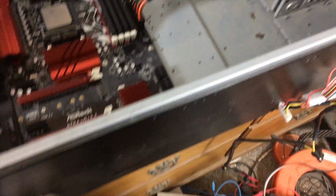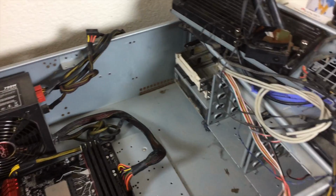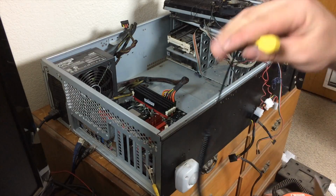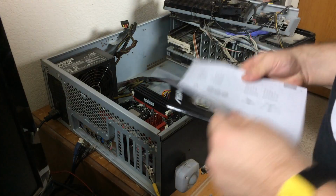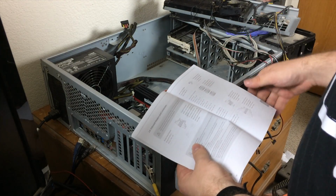RAM is installed. So now we are going to start cabling up the chassis connectors, all of which are here. Then we can start rebuilding the mess that I just yanked out of there, because there was some extra stuff, and with the configuration change, it's easier to start fresh sometimes. Most of the connectors on the motherboard in relation to the chassis front panel connectors are labeled, but some of them are a little bit more obscure in terms of their labeling. So always use the manual when you're plugging stuff back in. It gives you a nice breakout usually of how things should go.